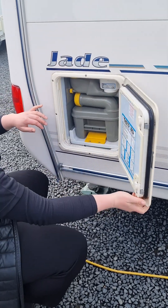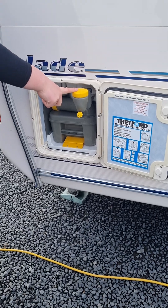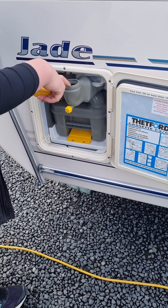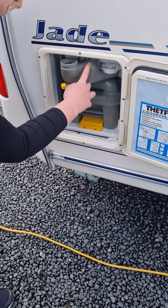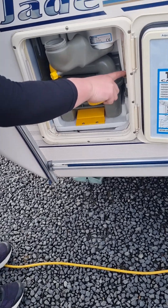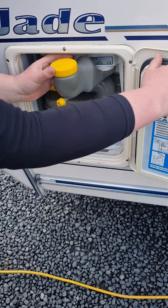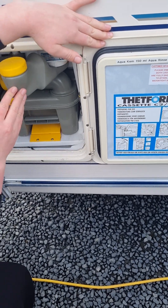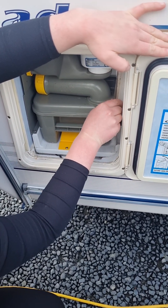On the back corner here in this little locker, this is where your toilet cassette is and also where you fill up the flush water for your toilet. This top piece spins out — this is where you put the fresh water for your toilet flush. Depending on the model, it generally takes about 8 to 10 litres. There is also a pink toilet chemical that goes in here — it helps with smell but also lubricates all the seals inside your pump. There's a bit of a hump so it may look full, but just keep pouring water in and it'll push over that hump. There is a little glass tube on the side so you can keep an eye on when it's getting full. When storing the van, especially over winter, it's really important that you empty this out so your pump doesn't seize or get frost damage. Spin off the little connection at the end, pull this piece off at the side and pull it down — that'll release it. You can then tip it over and drain out all the water.